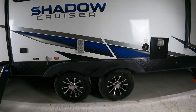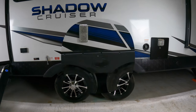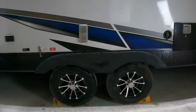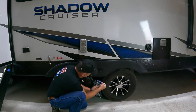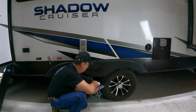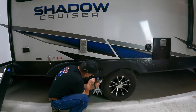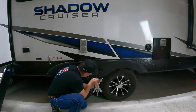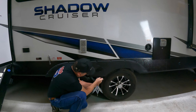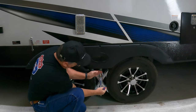As you can see in this video clip, I shake the trailer from inside and you can see the forward-to-back movement as well as the up-and-down movement — that's what the X-Chock is going to help eliminate. This next clip shows with the wheel chocks in place, and you can still see a lot of movement even with them. It looks like mine is going to fit like this, and I can still put it on top, which is nice. If your skirt hangs down lower, you can flip it over and use the wrench from the lower side. The feet on this actually pivot so they contour to both tires and make it nice and secure.